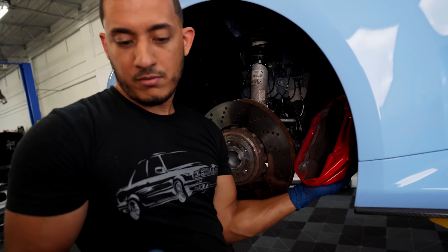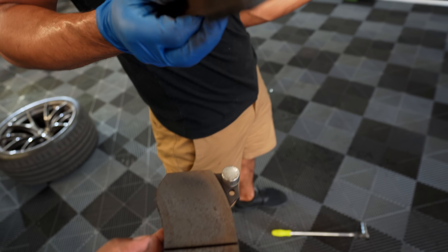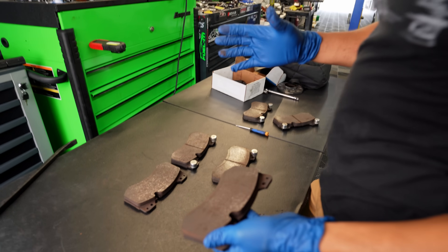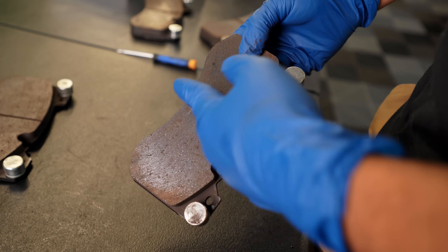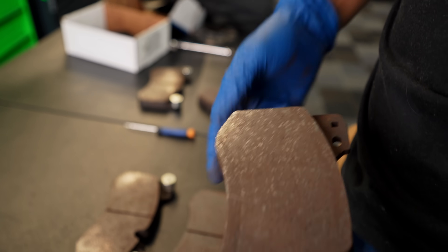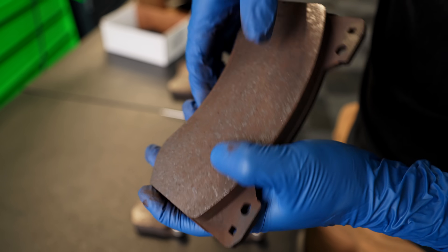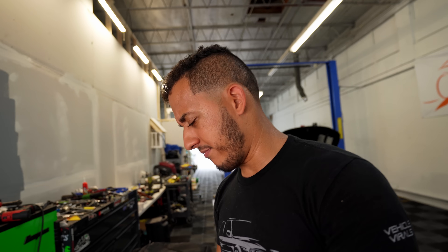What is this? Look at the two surfaces - this is glazed. So the M3 ones and the M2 ones don't look identical. The more I looked at the M2 pads, the more curious I became. Why didn't they have the weights and the cut in the middle like the G80 M3 pads? Was that a way to cut costs or just a lower tier pad for the M2? You've got little spots right here where it's starting to chunk off - it just comes off. Thought it was the same calipers, brakes, and rotors for the M2, M3, and M4, but for whatever reason it seems like the M2 got different ones.